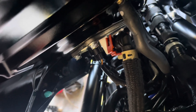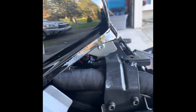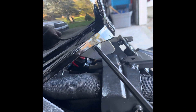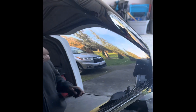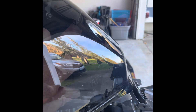Remove the two vacuum lines, the fuel line, and the fuel pump plug. Then remove this bolt and you can lift the tank right off — it has an almost handle-like spot to carry it, which is handy. You might be able to do this without removing the tank, but it's such an easy tank to remove that it would be crazy to try to work around it.